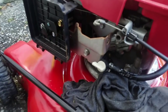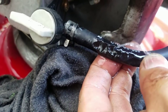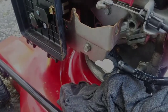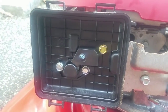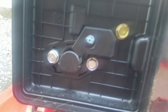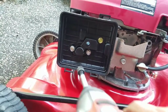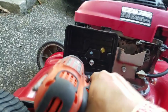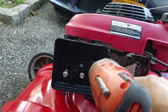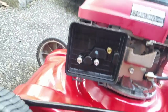I shot some spray in there and it started for a second, then it stopped. So there's also a fuel leak here. I'm gonna have to fix that and figure out why fuel is not getting in. I changed the fuel line and it still doesn't start, so I'm going to remove the carburetor by taking off these two bolts and that bolt to get the air cleaner cover off. At least Honda uses the same bolts for everything — makes it a lot easier.